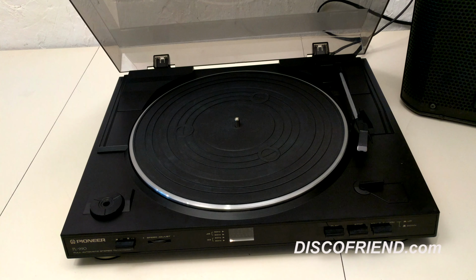Unlike the way turntables once were, this one does not require a phono input channel, which is a more sensitive input channel that boosts the volume for the phono needle. This already has that inside it. So all you need to do is plug it into your line level option on your stereo receiver. No need to go out and have a receiver that has a special phono channel.